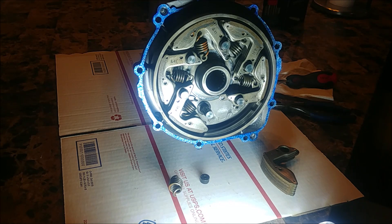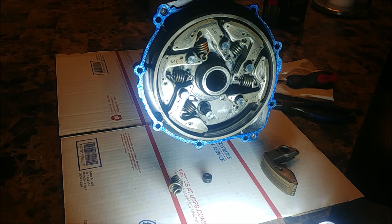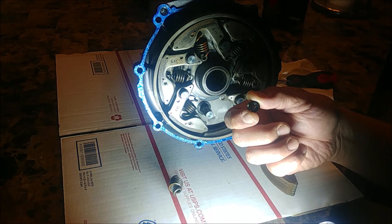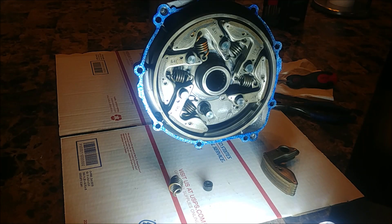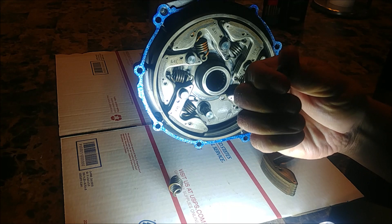When I first found out that the X2 and X4's wet clutch functions like the Teryx with these rubber inserts, I was concerned about long-term use and whether they would break down. Well, the good news is they didn't break down — they didn't fall apart, because I didn't want rubber getting inside my engine. But like I said, they got egg-shaped.